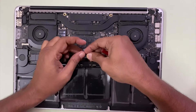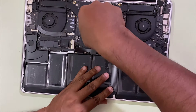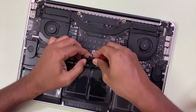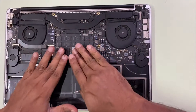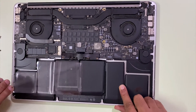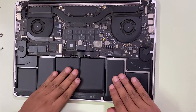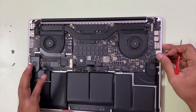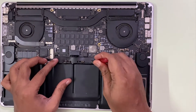Remove the plastic tape above the batteries and make sure that it latches in properly. Once you latch it up properly, you have to screw the batteries back in again like how we unscrewed them before. Also remove this tape so that it doesn't create too much heat inside the circuit and the logic board area, then screw it again and connect your other screws as well — the ones which you removed from the sides.